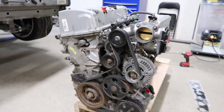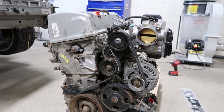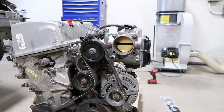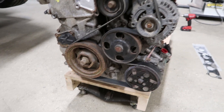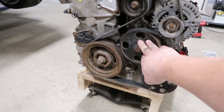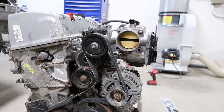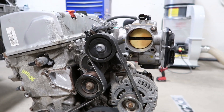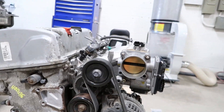In regards to the accessories, I was torn trying to figure out what to do about power steering, because obviously I want to keep power steering and AC. AC is not a problem - you can keep the OEM Honda AC. Water pump's no problem, alternator's no problem. But keeping the power steering, at least the hydraulic pump on the engine, is not going to be possible - it shares the exact same space as the throttle body.